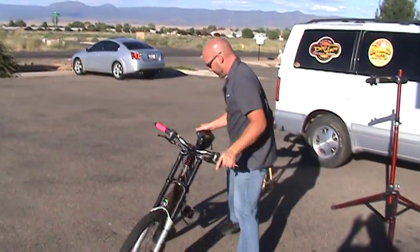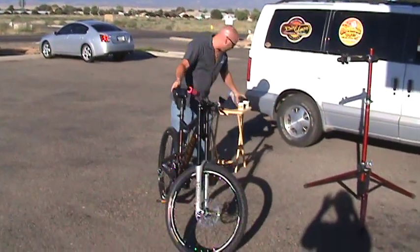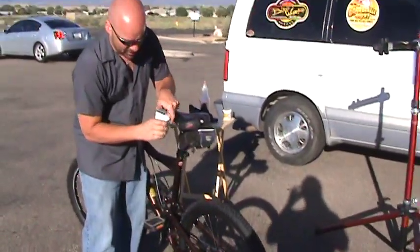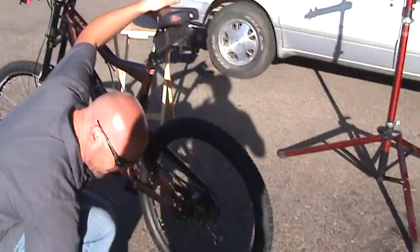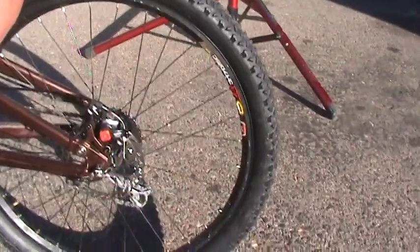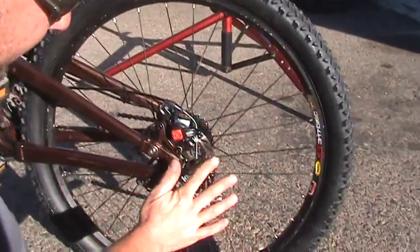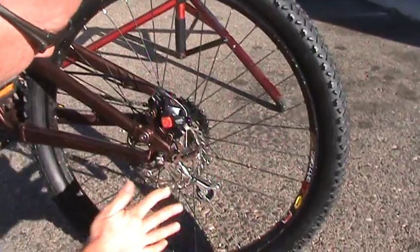There's no shortage of these. What I'm going to do is put on a small amount of squeal-out disc brake paste to the rotor. It doesn't take much, just a little bit. You just dab it on the rotor. Sometimes you might have to add a little water to the paste if it's dried up at all. It doesn't take a whole lot. You're going to do both sides of the rotor.